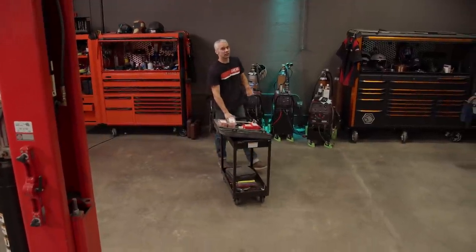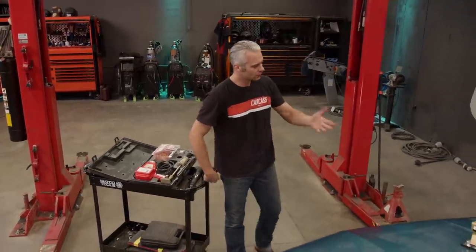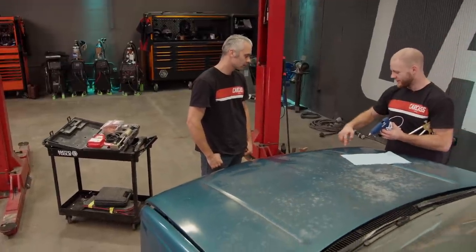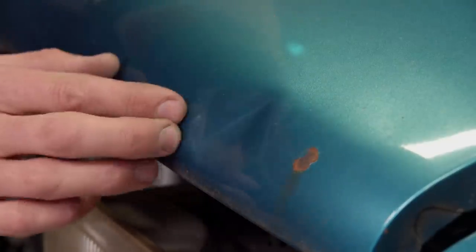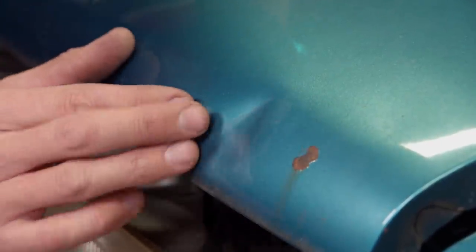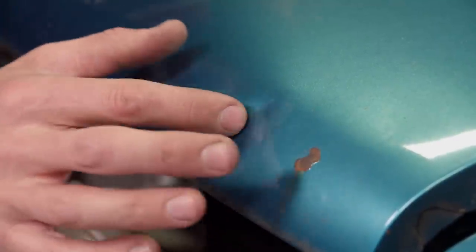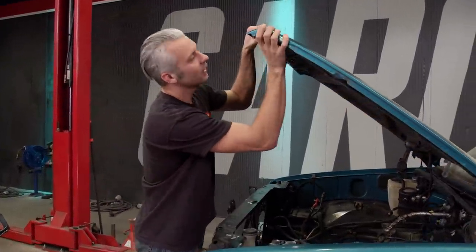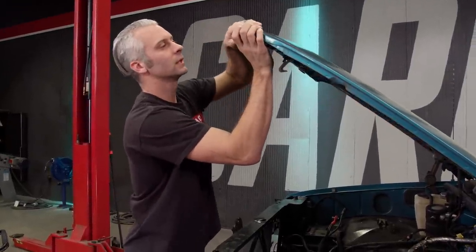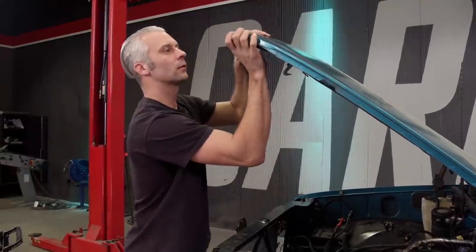To take care of the dents on the other side of the hood, we're going to have to do something a little more aggressive and use a tool called a stud gun — that involves removing some paint. There are actually two creases in this dent, which is why we can't use the glue gun — it would take entirely too much force. But before we start grinding paint to put studs on, we're going to take a really good look on the backside because we might be able to push on that dent from the back. There's actually a little access hole back here — a manufacturing hole — and I can feel the dent. We'll grab some picks and see if we can't push this out just a little bit to reduce how much work the stud gun has to do.